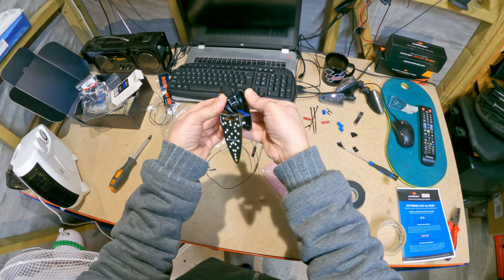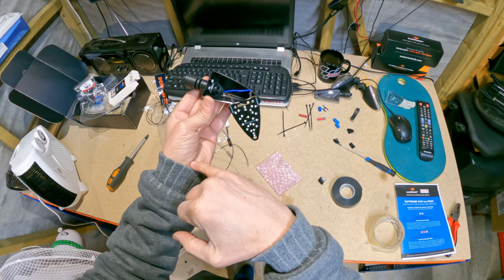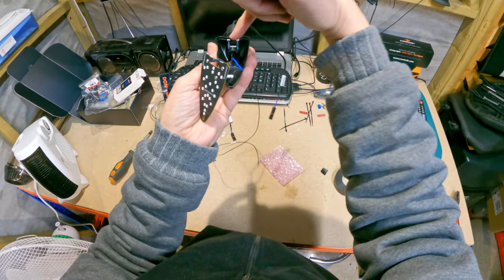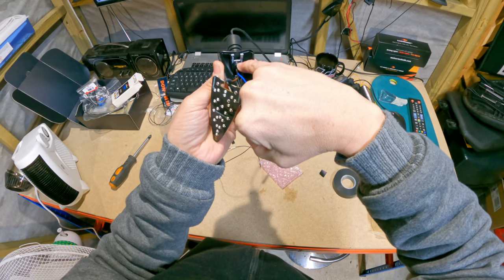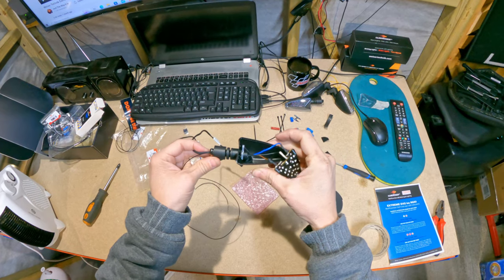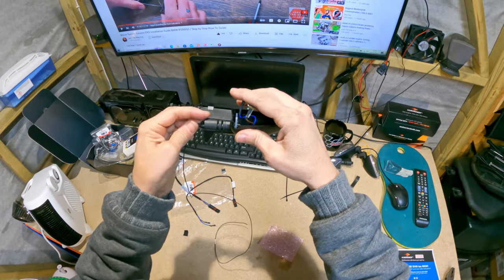Three cables remember - left-hand front indicator. This black long cable is going to reach over to the right indicator from the left, and this one just connects to your motorbike connector. Now we need one of the front indicator PCBs - it has three terminals: V-plus 12, Term-plus, and Earth. The black cable goes onto the V-plus 12 terminal. The blue cable goes onto the Term-plus terminal. Brown goes to the Earth terminal. Then I take one of these little keys - one side says 'insert elko free', the other says 'bike side'.